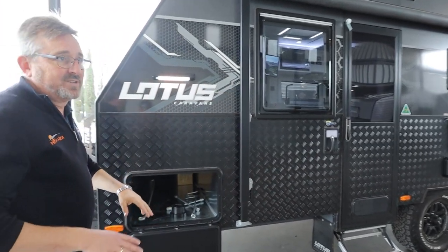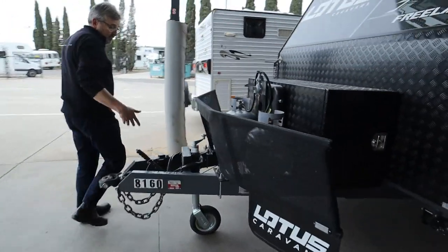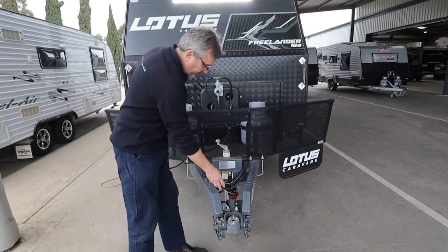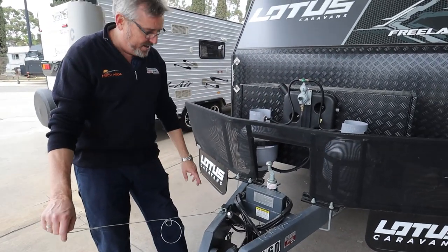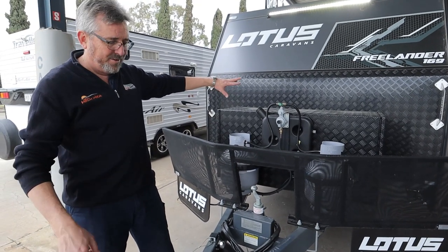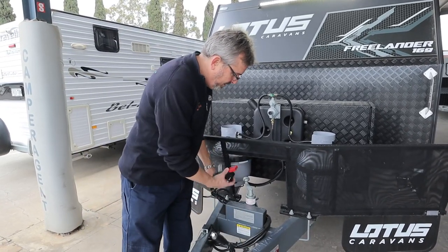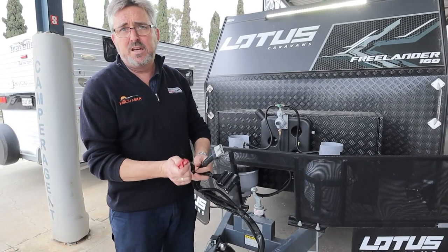Now we'll talk about the rest of the outside of your van. When you get it off your car, we'll show you the DO35 pin - I'll show you where I've stashed that. Make sure you whack your handbrake on. This cord will be attached to your vehicle somewhere because if this pin pulls out, your electric brakes come on full lock. So if it disconnects from your car, it's not going to go into that lane or in the paddock - it stops on the road where it's meant to. Your wiring - hopefully you've been sent this already - that's for your ESC.